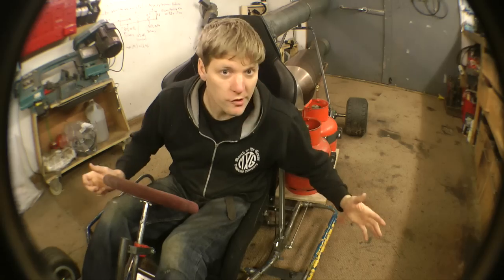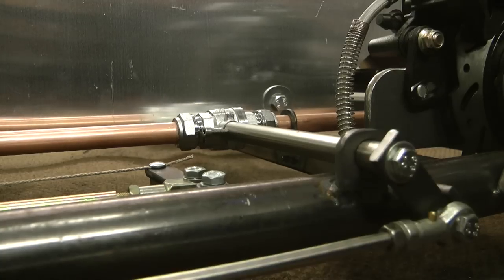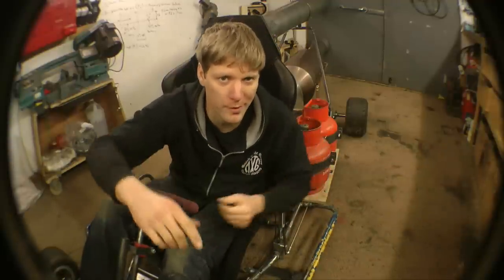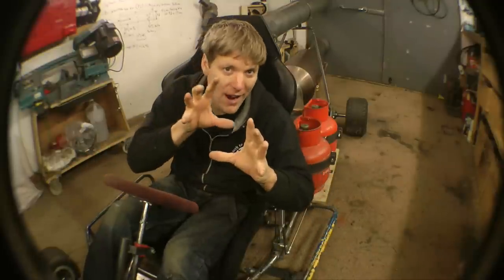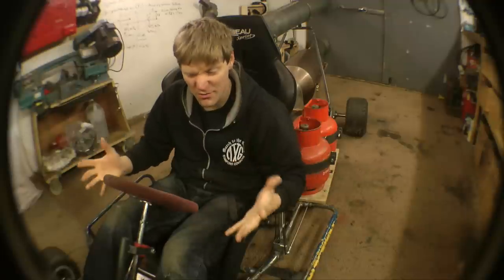So there we are — our gas idling system. Got a little lever here which I can set it with. Also added a spark plug — I'll just press this little button here and hopefully that'll light the gas. Now the next bit I'd normally do is go around the back and stick a leaf blower in and it would jump into life. But I'm gonna try another experiment — a system where I can blow air into it and get it started so I can do everything from my seat. It's not quite turning a key, but for a pulsejet-powered go-kart, that's pretty good.